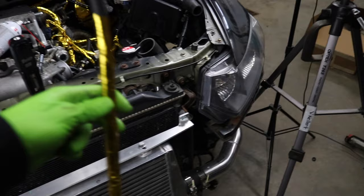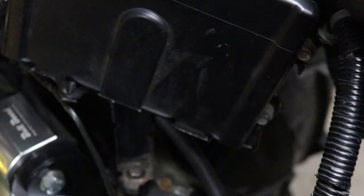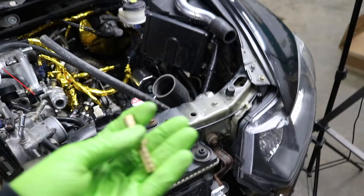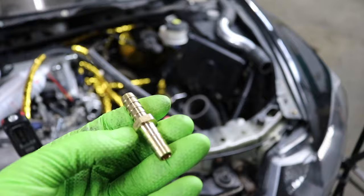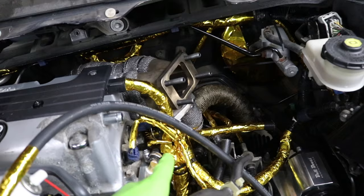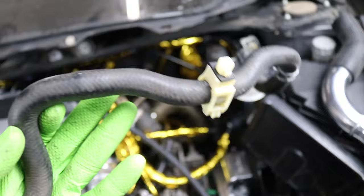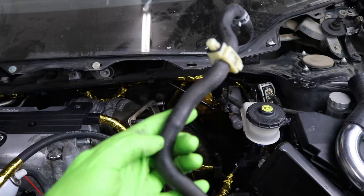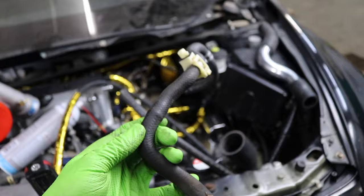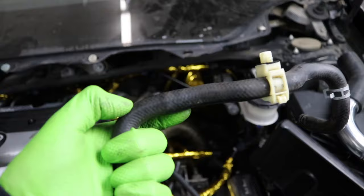I found it. Here is a 5/8 line that I just finished building. I gold heat taped it right to the point where it's going to be going behind the ECU. Right by the ECU is where we are going to hide our check valve so you can barely see it. And we are going to use a straight 3/8 to 3/8 barb fitting on each side of it to adapt the factory check valve. This is the factory hose that goes into the vacuum booster and then runs to those hard lines from stock that are all right here, goes to another pipe that goes to another soft hose that goes to the intake manifold for vacuum so that you get brakes. If you look at this hose real nice and close, there's a little lump in it — that is a check valve. We need to cut this on either side with enough space for a barb fitting.